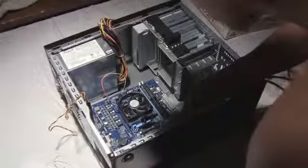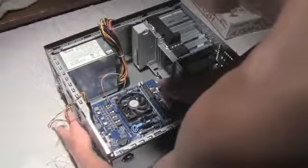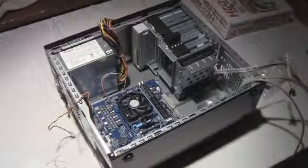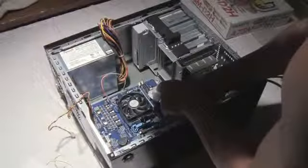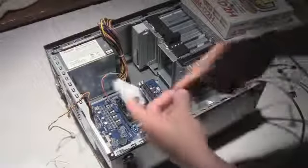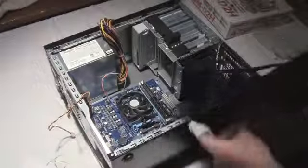Now, after you have this thing on the motherboard standoffs, then you can start screwing it down. But you don't want to screw it on the same sides. You want to do opposite corners, okay? So now we just take a screwdriver and start screwing into the motherboard standoffs. I'm very scared to do this, especially with my injured finger. I feel like I can't even do anything right.